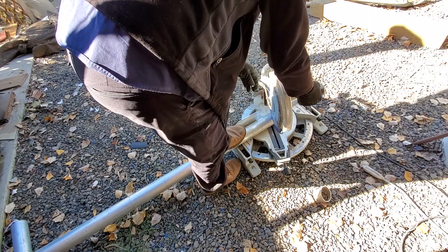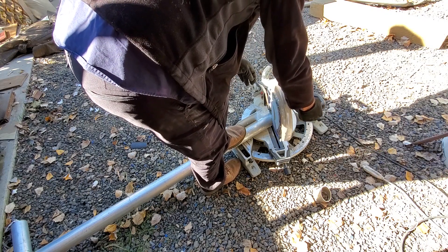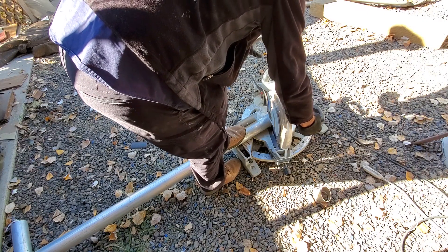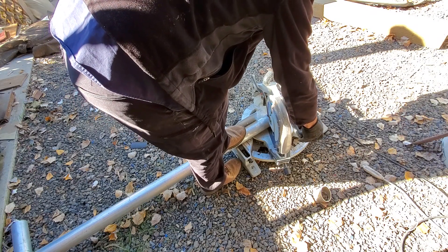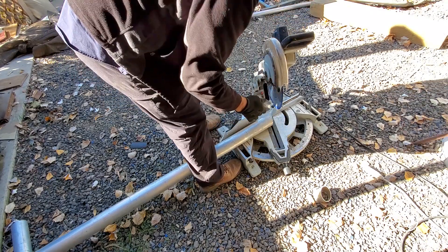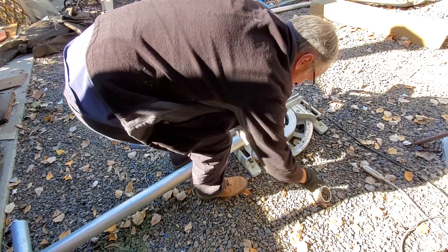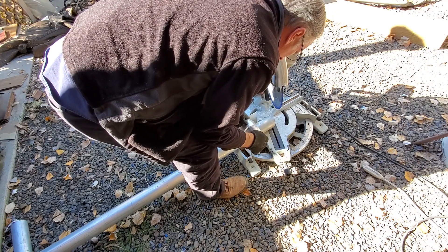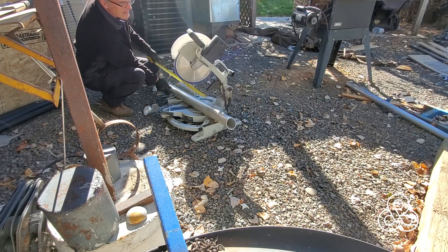Here we are at the crossover tube. We're going to be fabricating this thing out of 3-inch 6061 tubing picked up from the scrapyard. I think they have a thousand miles of this stuff because we're in a farming area. This tubing comes out of pivots and irrigation systems, so they get a lot in the scrapyards. But we're going to clean it up and make us a crossover tube, with 22.5-degree pie cuts to make us a 90-degree bend to get this thing to pass through our firewall.